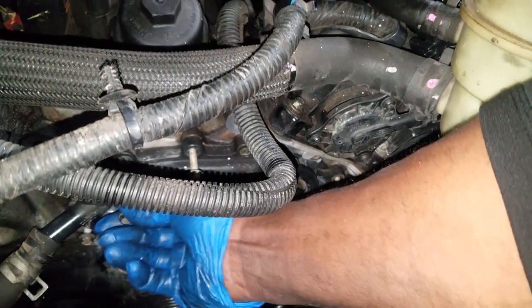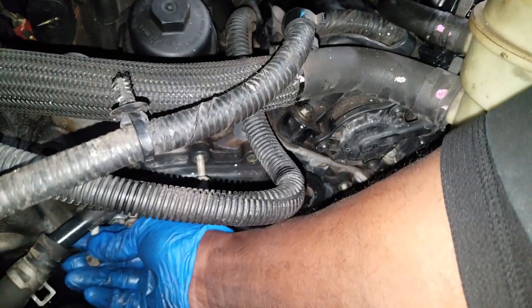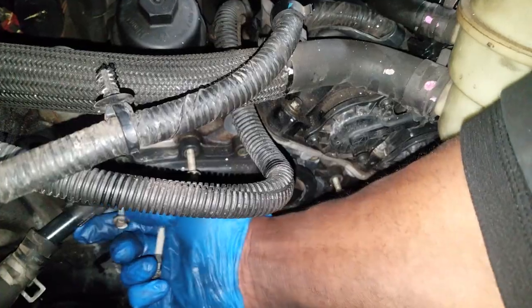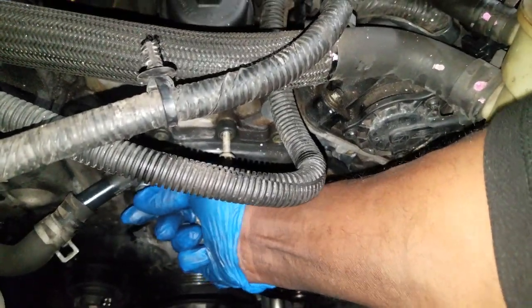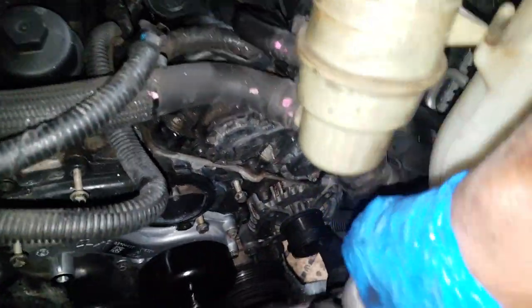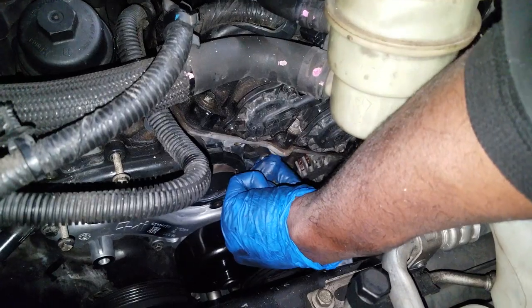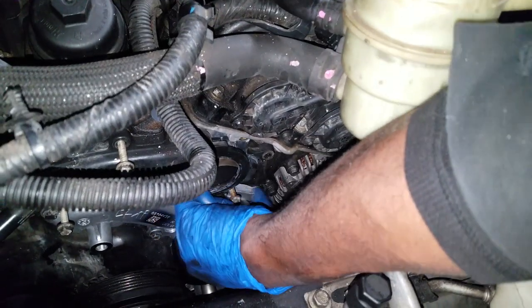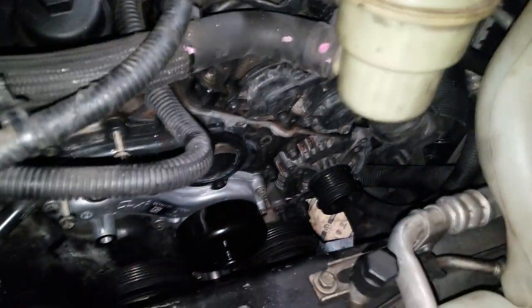I highly suspect it's cracked. They don't crack on their own, so something had to trigger that. Same with our oil filter adapter housing — a lot of those failures were self-inflicted. Lube guys were possibly tightening them up too tight. There is a torque spec on them, so we want to be careful about over-torquing them and cracking them.